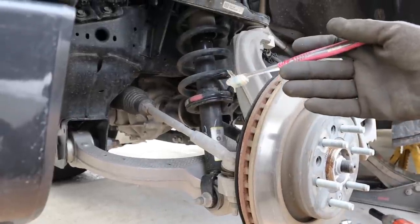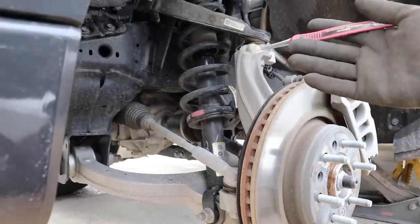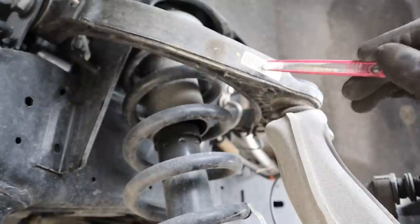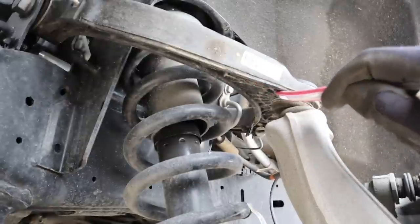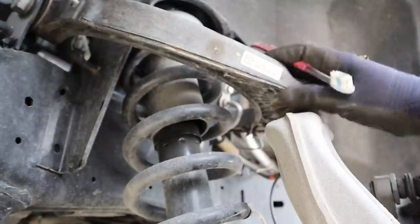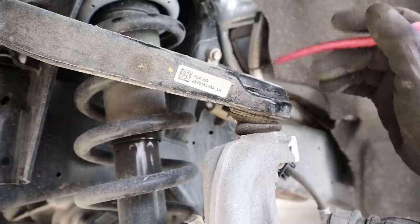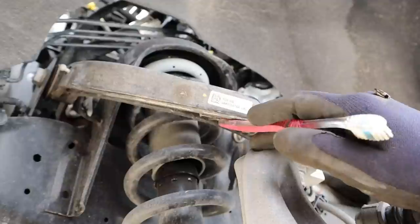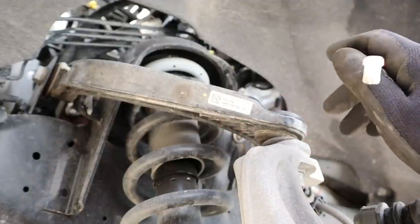With the wheel removed, taking a look at the front suspension, you can see we have a very simple double-wishbone design, which will definitely suit the entitled person who doesn't really take this thing off-road. Here's one interesting thing — we have a composite upper control arm. You have your typical stamped steel on the outside, but on the inside here there's plastic reinforcing it, forming a composite between the two. That makes it a lot more rigid but a lot lighter than just using a forged control arm. The ball joint here also seems to be plastic, so I'm not sure if that's replaceable — I'd probably opt for replacing this with a proper aftermarket control arm when it does fail. I guess plastic is starting to make its way more into structural components, and that's the future, especially with lightweighting.